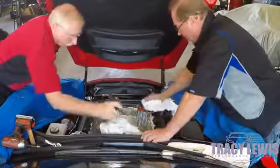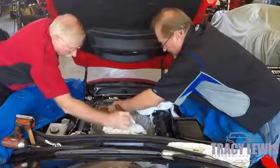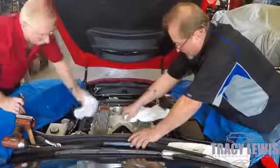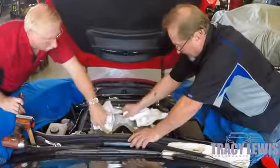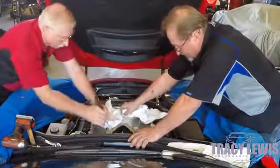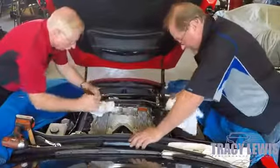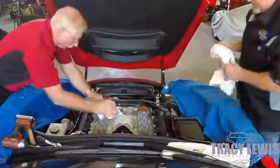Nothing good comes from oil being ingested in the intake air charge. This is all coming from the valve located underneath this bypass, and that is drawing that oil in. You do not want to vent or put a breather or anything like that on the system that's going to break this closed evacuation system.